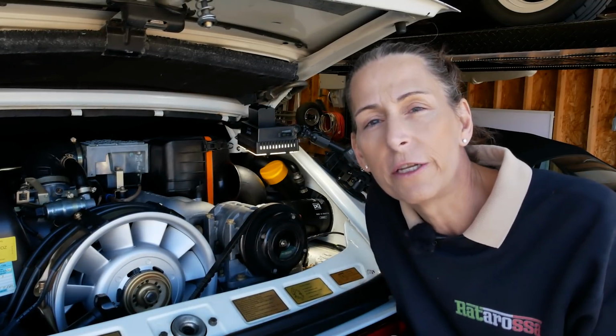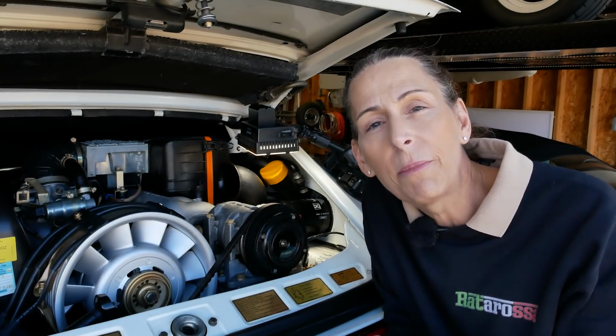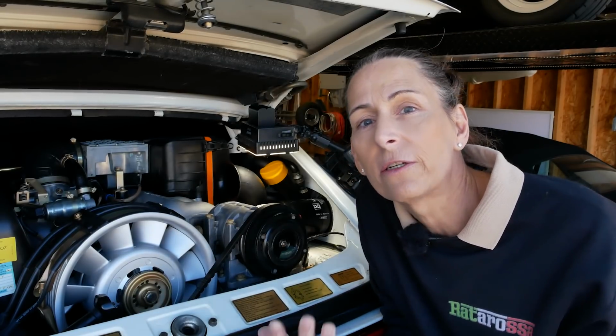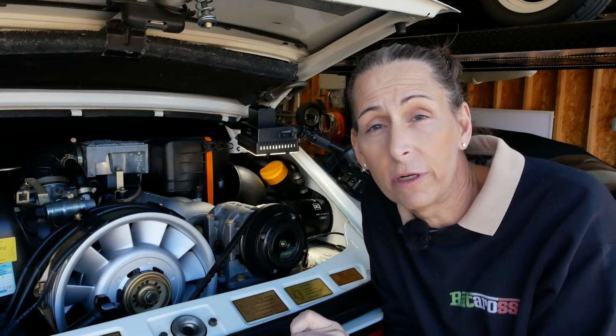You know, I doubt seriously there's anything wrong with the cylinder, but there is another test we can do for our injector, and that is to pop off the fuel rail, pull it out, and swap it with one of the other cylinders. Since we know that the other 5 cylinders are working just fine, we can swap it with a known good injector and see if the problem follows the injector. If it doesn't follow the injector, then it's cylinder related. If it does follow the injector, it's obviously the injector, and we'd have to get back with RC injection and find out why that injector isn't working.